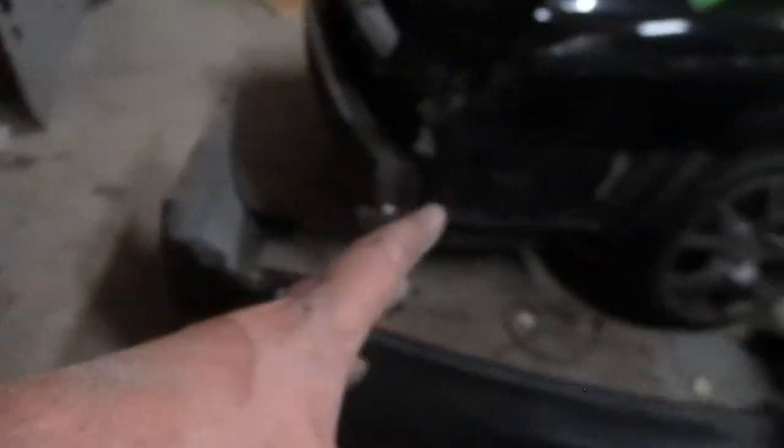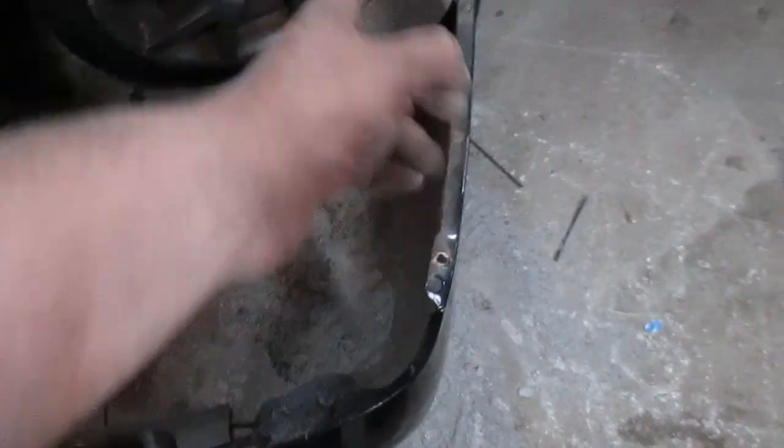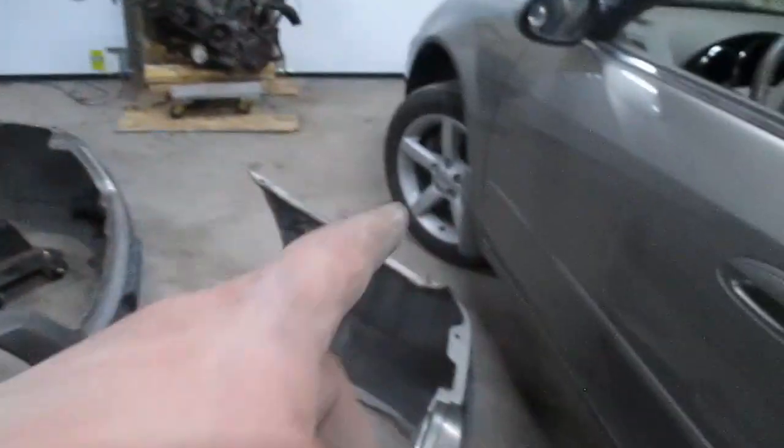The 3.5 SE bumper is off — that took quite a bit longer than I expected, but they're both off. As you can see, this styrofoam piece is quite a bit thinner than the SER one, so we're taking the SER styrofoam and putting it underneath the bumper. On one side the clips actually broke in a few spots, but on this side we still have the tabs intact. I don't think this bumper was rusted — I think it was repaired recently — so I'm going to take the clips off this bumper and put them on the other.